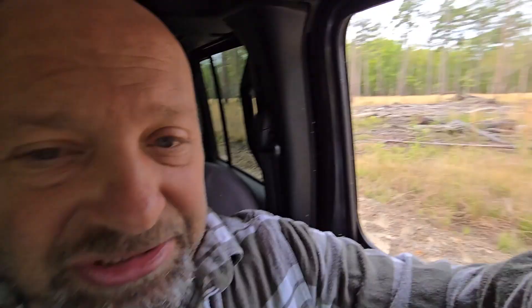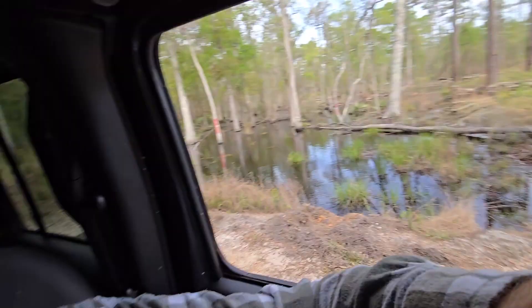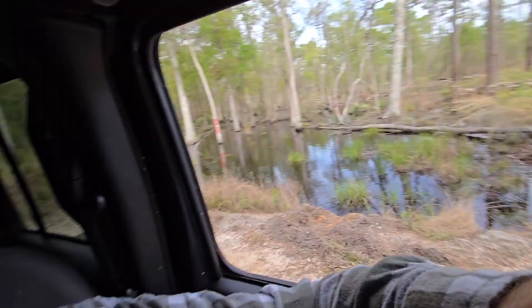If you have a Toyota with a knob or a button on the console, just turn the knob or push the button — you can do this while driving any time you want. It's a beautiful thing out here because if you run into any potholes or washes, you can on-the-fly shift into four high when things get a little soupy. Or leave it in there all the time — every time you're out here it will not hurt anything. Maybe your gas mileage just a smidge, but there is nothing wrong with being in four high on a regular basis, keeping speeds under 55.